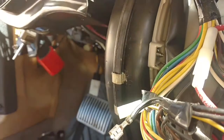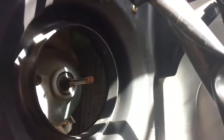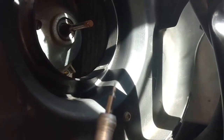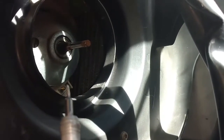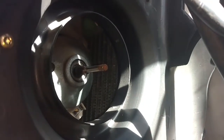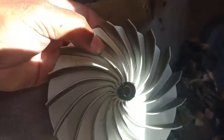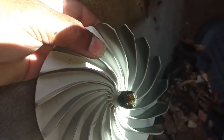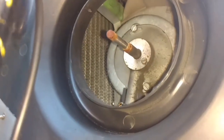He's going to be working on the other side getting all of those clips off so he can get that side out. I put a real tiny tip screwdriver under that clip and put a bigger flat screwdriver under the end of it, slid that clip a little bit to one side, and it came right off. Then I slid the blade out. Looks like the shaft has a key — I guess it's got a little bit of a flat spot there. Fan blade retainer off, got the blade off.